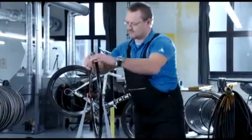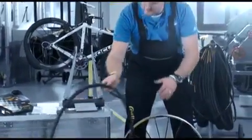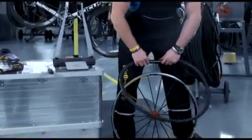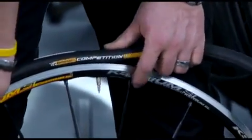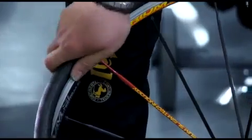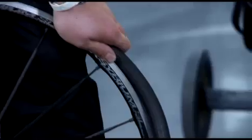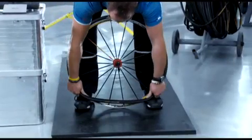Apply another thin coat of rim cement to the tire's seam protector. Place the rim on the floor with the valve hole facing up. Insert the valve of the slightly inflated and thus round tire in the rim's valve hole and press down firmly. Grasp the tire to the left and right of the valve with both hands and put it into the rim bed section by section, rolling and pulling it slightly. Make sure that the tire sidewalls do not come in contact with the cement bed or they will look dirty.